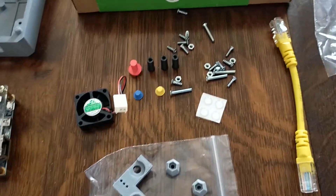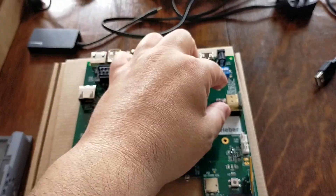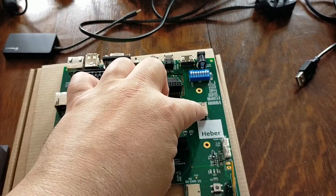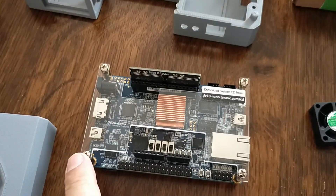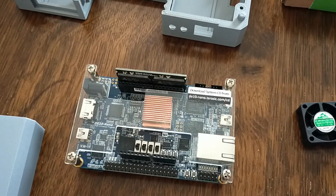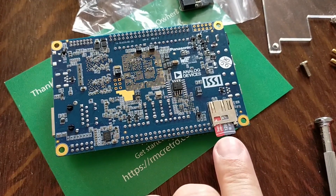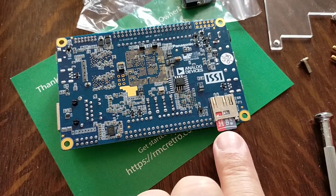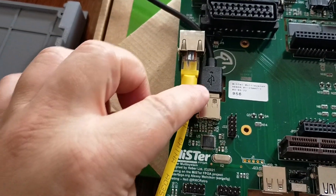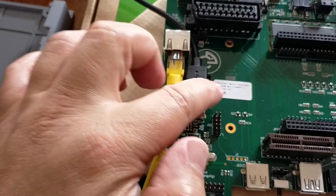Here's all the contents tipped out, including some extra 3D parts that are going to go into the case. Very importantly, you remove this HDMI bridge connector — make sure you catch that — and also take apart your MiSTer and remove all the standard bits it comes with, including your memory card. Very importantly, remove your SD card if you don't want to accidentally snap it. That does get flagged in the manual. Fitting these cables, as you can see, is really tight — make sure you fit the USB one first, otherwise it's almost impossible.